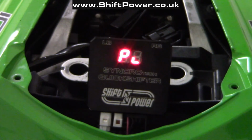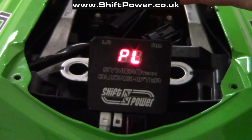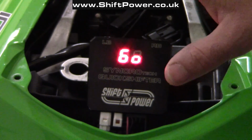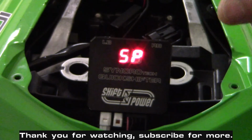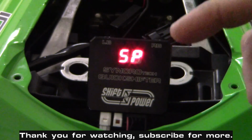In my case, I have to press the gear lever down. That's it. That's maximum travel. So I'm going to release it, and that's it. This sensor has been calibrated to this control box. You don't need to do that if you receive your control box brand new, it has been pre-calibrated from the factory. You only need to calibrate a sensor if you're replacing it with a new sensor or if you have reset the control box. That's it.